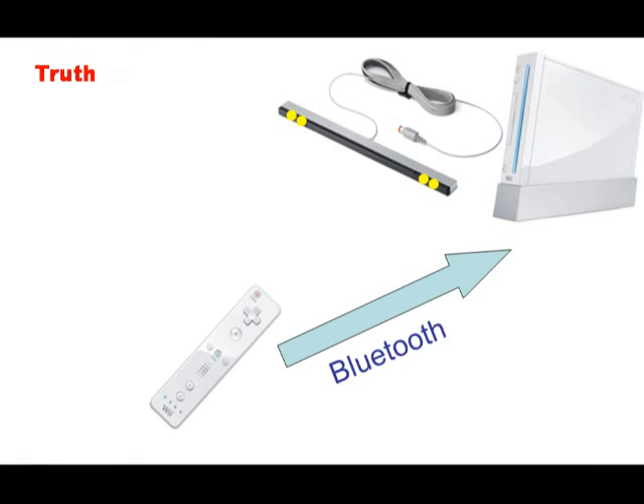When you move the Wii remote closer to the sensor bar, however, the dots will become bigger as well as the distance between them will grow. So what this means is that by observing the motion of the infrared dots, we can tell how the Wii remote is moving. This information is then transmitted to the Wii system wirelessly via Bluetooth technology.